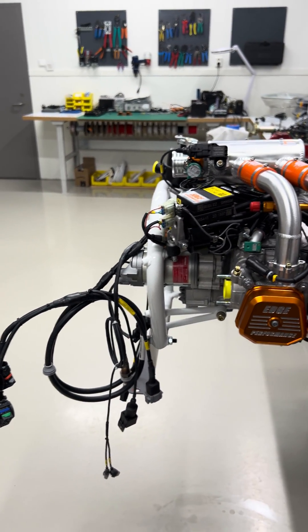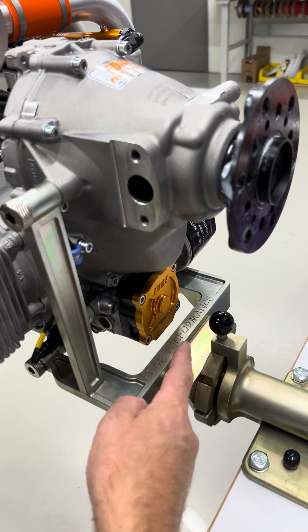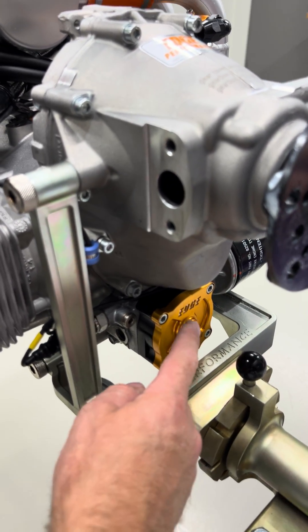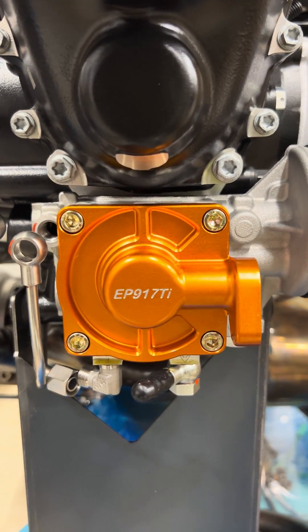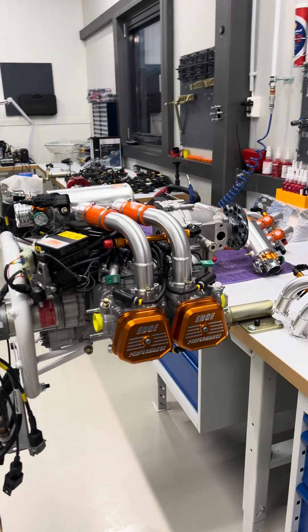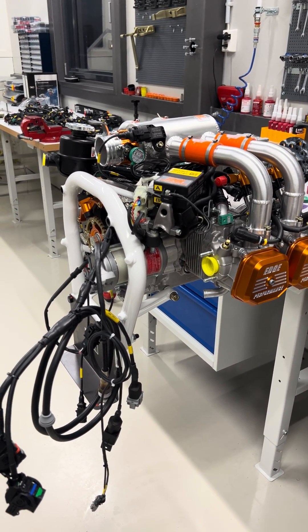So that's a quick overview of some of the new features of the 912 STI Gen2. We also have in the works a revised oil pump cover, which will have a new cover, a new shaft, and also a camshaft position sensor — much like what we have on the 917 TI. I'll show you real quick here — that's the cam cover with a sensor port on it — and that will allow us to run the engine on fully sequential ignition and fuel timing.